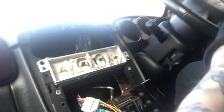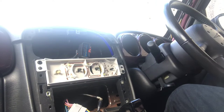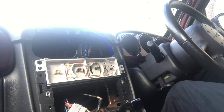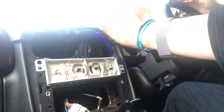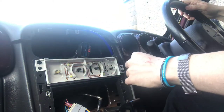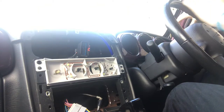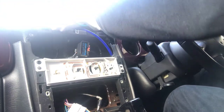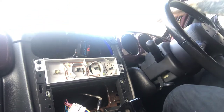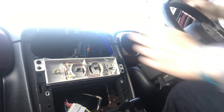This wee spot here seems to work pretty well. You're sitting on my little girl's Batman seat, so I hope you feel honoured. All you need to do is: the front fascia comes off - I've shown you how in previous videos. Knobs come off, power window control comes off, screw comes out of there, two screws out of there, and the two pillar covers come off. Then pull the dash and she slides right out - and goes back in equally easily. The dashboard clips in and out just that easily - no drama, no hassle, no fuss.